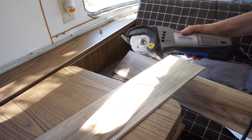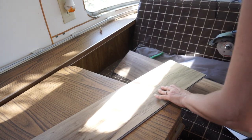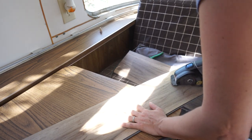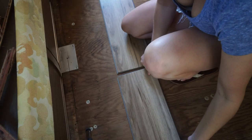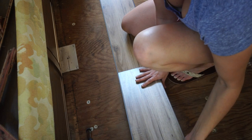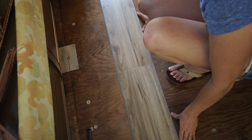I'm going to show you how using the Dremel SawMax with a plastic blade is fast and easy. There's a notch here which is what you line up with the line on your board that you've already drawn out after measuring. We're basically just going to follow along that notch and cut our board. See how we're doing on our control line here — looks pretty good, so let's keep going. Whenever you snap these together, you want to make sure that not only are they clicking and locking, but that they're also lining up well, especially since we're not laying it row by row.